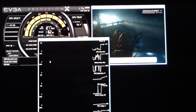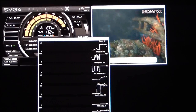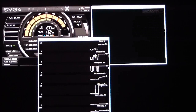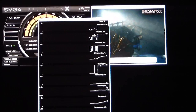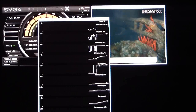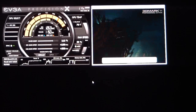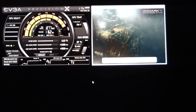Let's take a look at the performance. You'll notice that as it runs at those clock speeds, you'll see how much of a boost I'm getting in real time — what the GPU clock is staying at, going up and down. I'm at 116%, 112%. This is my memory clock speed, GPU usage anywhere from 96 to 98%, GPU voltage, fan speeds, and the fan tachometer RPMs. So technically, that's a quick and simple way to performance tune your GTX 680 using the EVGA Precision tool. Hope you enjoyed the tutorial. Thanks for watching — we'll see you next time. Stay thirsty, my friends.